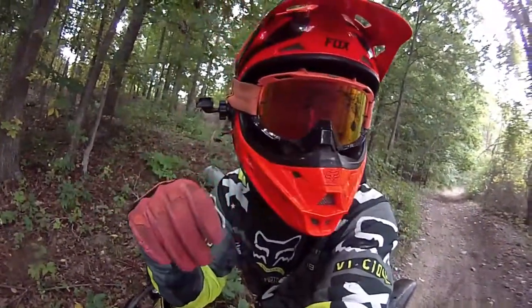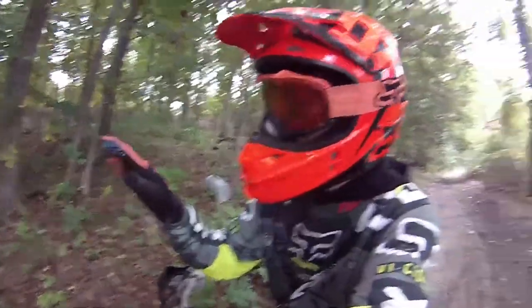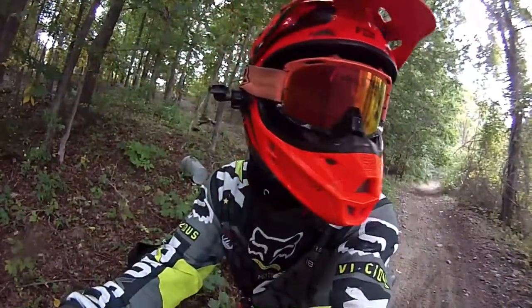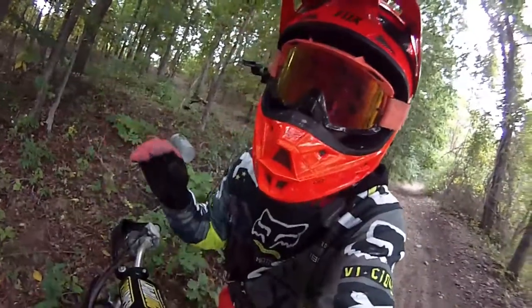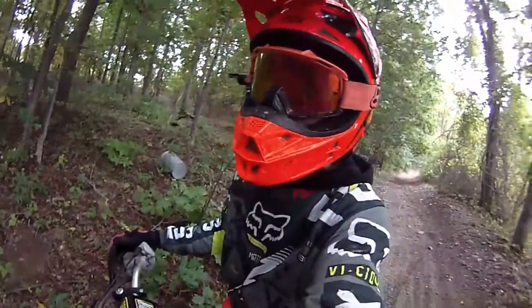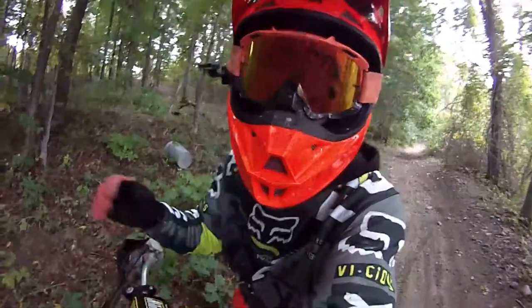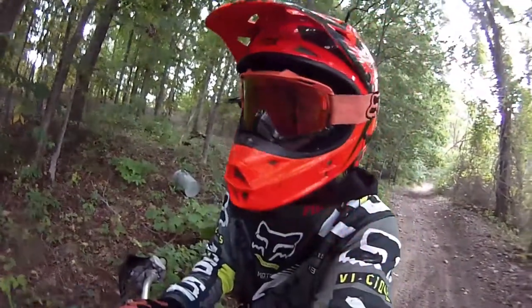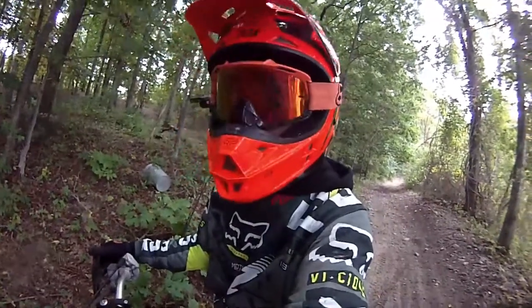You saw that I was completely stopped on a hill climb. It's not really a steep hill climb, but it had some gain to it. I was stopped right on it in second gear, and I just lugged up it like a tractor. That was impressive, because if I didn't have that weight, that thing would be jerking back and forth up the hill. Probably stalled too. I had to feather the clutch pretty good, but this flywheel weight's pretty good.